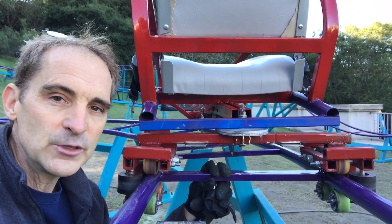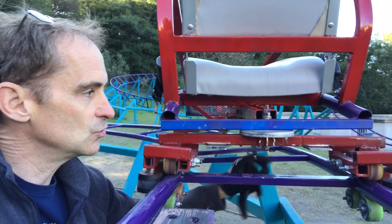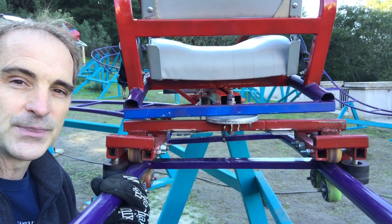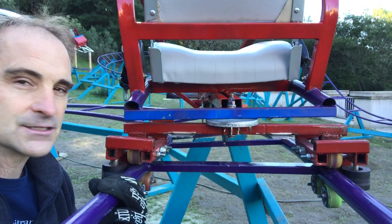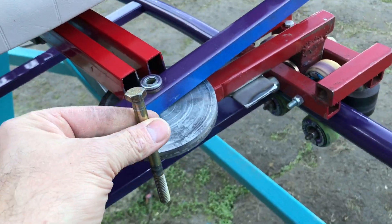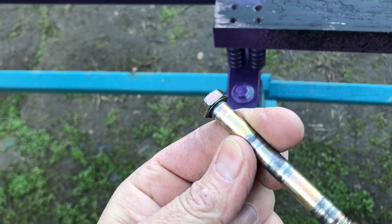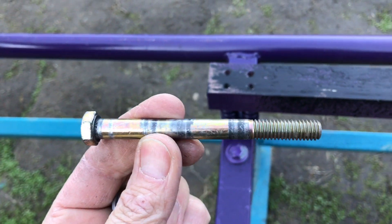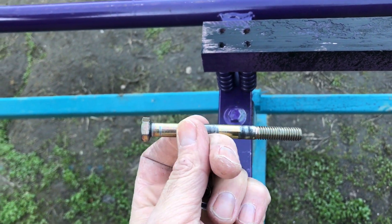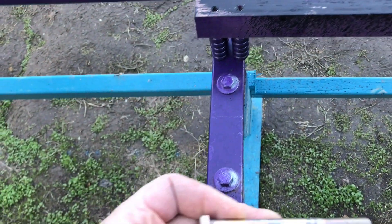That's what is stressing and bending this grade 8 steel bolt. What I've got to do is rebuild the brakes on the cart so that the brakes are attached to the body of the cart rather than the wheel assembly — and I think that's gonna solve the problem. I just took this bolt out; it's just resting there by gravity right now. Looking at the grade 8 steel bolt, this makes me feel very happy — there isn't really anything wrong with it. Some of the color has been scraped off, but these are incredibly strong.